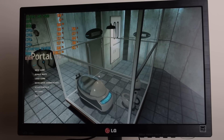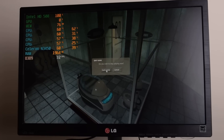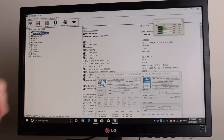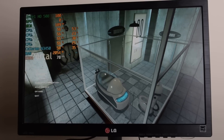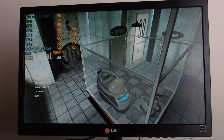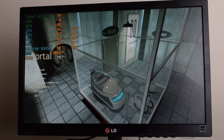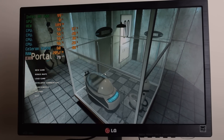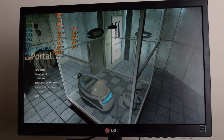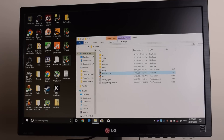At this point we're going to quit the game and increase the power limit even further. Back in hardware info, the 15-watt power limit is active, but unfortunately not much has changed. The performance and temperatures seem to be the same and the power meter is only reading around 10 watts. There might be another limitation in the BIOS that doesn't let you override the power limit. We're going to try the unlimited option and see if that makes a difference.